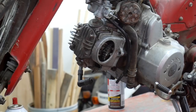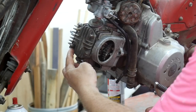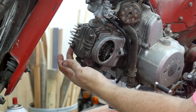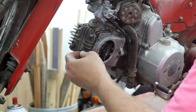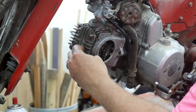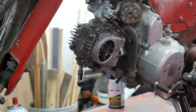As I'm putting it back together, I'm noticing a couple of things, and these are just questions that I have. I'm not 100% sure. There's got to be a reason behind all of them. For example, this nut here on the cylinder head cap has a copper washer. And so the fact that it has a copper washer tells me that it's exposed to pressure. And so I'm guessing it's exposed to oil pressure, at least in this hole. Then this end here gets only a regular open nut and not a cap nut. I find that curious, and maybe it has to do with some other option that was available that needed to be grounded here or something. I'm not sure. And then the other two are just normal.